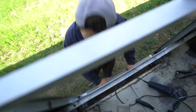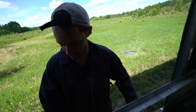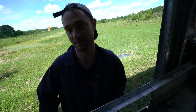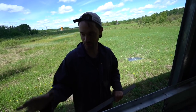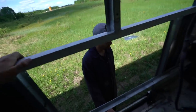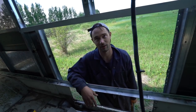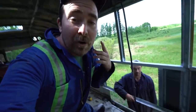Kodak went out of business but we have a Kodak moment here — we got this nice beam that is almost fitting perfectly in an almost straight line on a school bus. Nothing is straight on a school bus, so that's good. Because there used to be an emergency door here, there was no beam, so we have to re-weld the structure of the bus so that Jack's here — if anyone decides to hit him on a side impact, he'll be a little bit more safe. If anybody doesn't know how safe these buses are, just look up side impact school bus on YouTube.